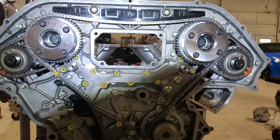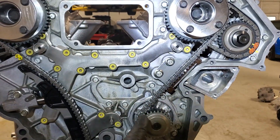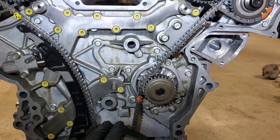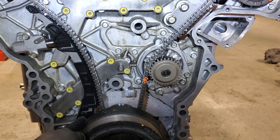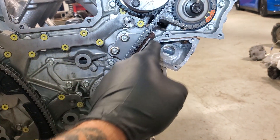I also don't have hydraulic pressure in any of my tensioners, so you want to work slow and be kind of careful. If you're having a problem getting the primary chain on, onto either the crankshaft, sometimes I'll do something a little different where I'll actually just remove this guide.